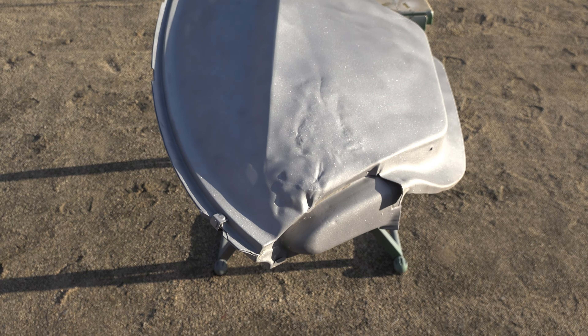After the high-build primer dries, I go ahead and flip the fenders back over so I can apply an undercoating. Instead of going with a traditional rubberized undercoating, I decided to give Eastwood's 2K Ceramic Chassis Paint a try. I figured this coating might be more durable and better looking than a rubberized undercoating — although the better looking part really doesn't matter. It's not like people would be looking at the backs of these fenders at car shows. And if someone did, they are a weirdo, and I would kindly ask them to leave.